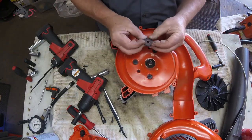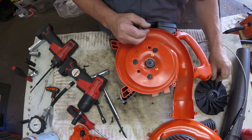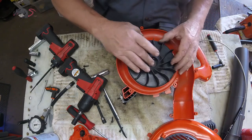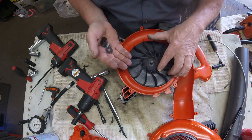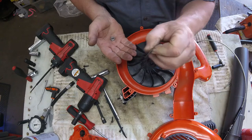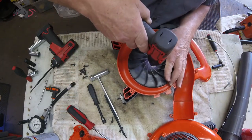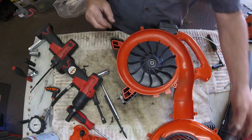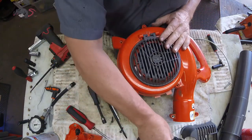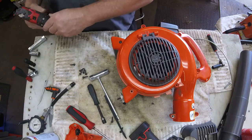This piece fell off when I flipped it over — I should have taken it off when I took the impeller off, but it can only go on one way if it's going to mate with that impeller. Get all that hardware in place — flat washer, concave washer, and our reverse-thread nut. The torque spec for this is three medium ugga-duggas, no more, no less. Now we can put the housing back together — seven coarse thread screws and the one screw that holds the blower tube in place.